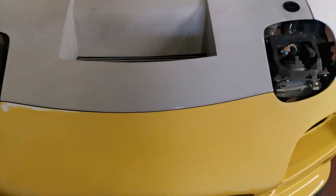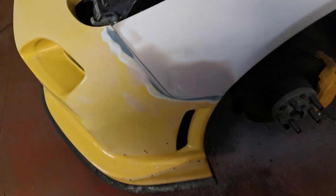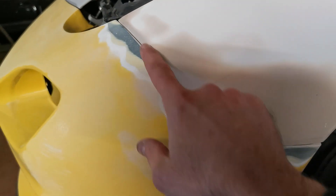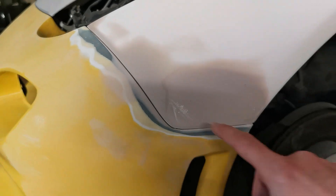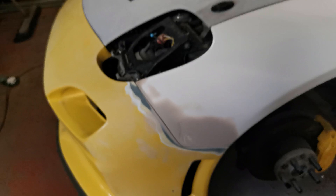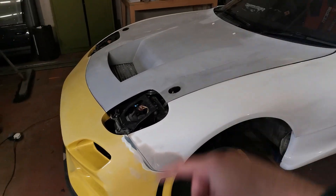Here's what the bonnet line looks like — nice and tight. I want that as tight as a card so that it looks like it's one piece, essentially. The angle of the bonnet is pretty bang on with the bumper. On the arches here — pretty happy with that gap, it looks pretty clean. I'll leave the alignment there now and then bodywork the panels off the car, because I'm going to paint all the separate panels off the car anyway.